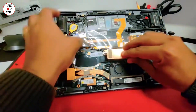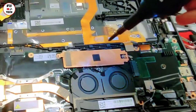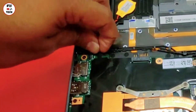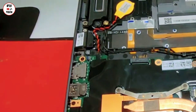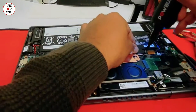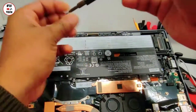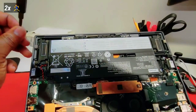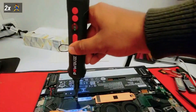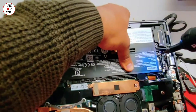Let's put the SSD back — same way you did it before but just in reverse. Same thing with the heatsink — let's screw them back. Let's connect the CMOS battery. Once you're done with the CMOS battery, let's connect the main battery. Just press firmly through the edges to help put it all together, and now let's do the screws. I tried to leave all power sources for the last thing I connect on the motherboard. That way you avoid damaging any component on the system board while you're working — you don't want any power source connected to the motherboard.